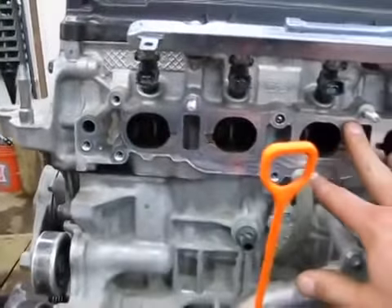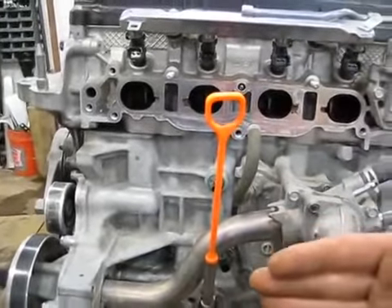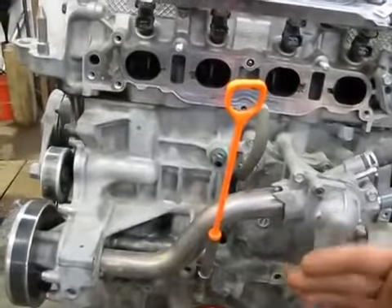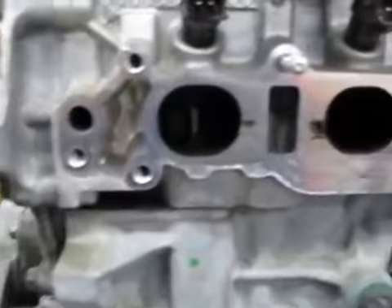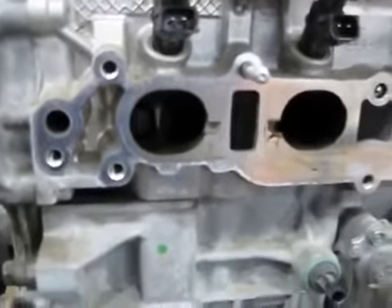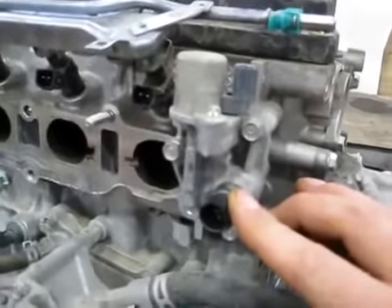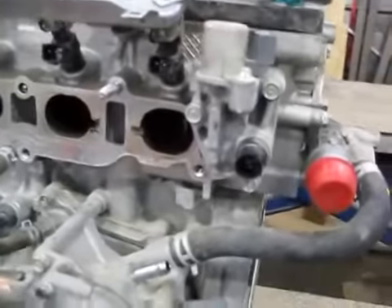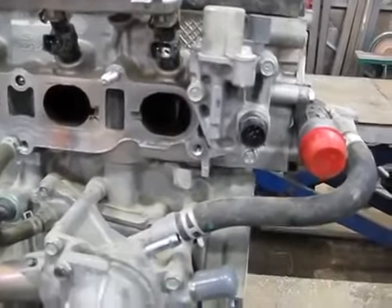Keep in mind that this is the intake side of the engine, which on the newer cars faces towards the radiator. The exhaust manifold is off the back of the car. So if you're standing with your knees to the bumper looking down at the engine, this is the front of the engine. We have intake ports — they have just the slightest little oval shape to them. Here is your VTEC control solenoid and your VTEC pressure sensor. I believe the VTEC kicks in at 5,800 RPMs, which is kind of where everybody's using the RPM for takeoff.